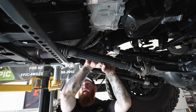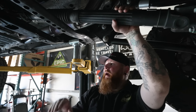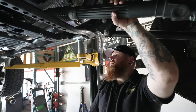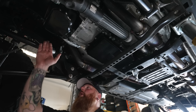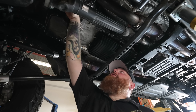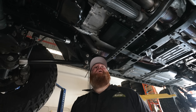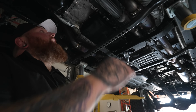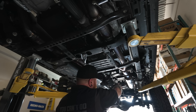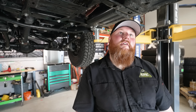So what's the issue with this drive shaft? It's way overextended. In the whole conversion, you end up moving the transfer case back about an inch or more, so it's pulling the drive shaft back. We've got the oil pan from a Power Wagon — it's steel. Heat shield over the starter. You've got the manifolds from the SRT8 or Trackhawk, Grand Cherokees. And then the exhaust is made completely by Magnaflow — the high-flow cats, the muffler, and the resonator all the way back.